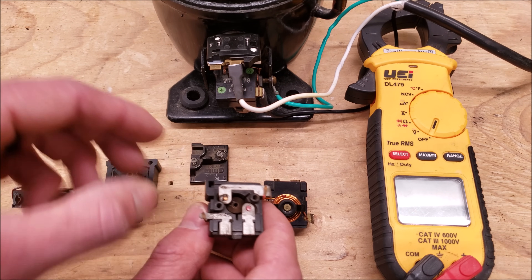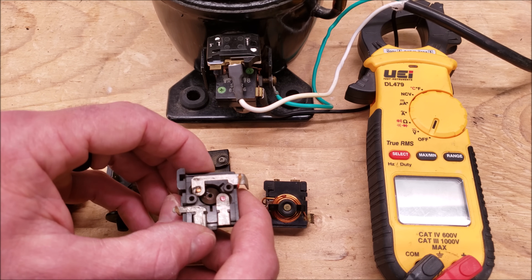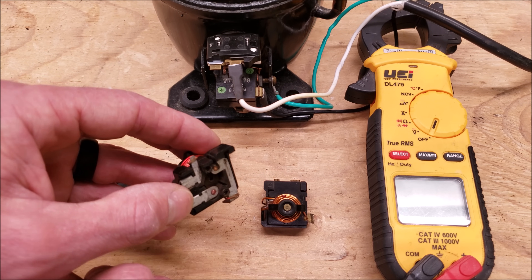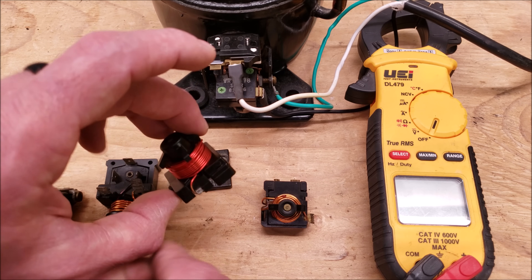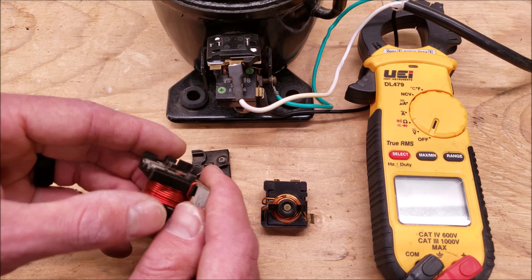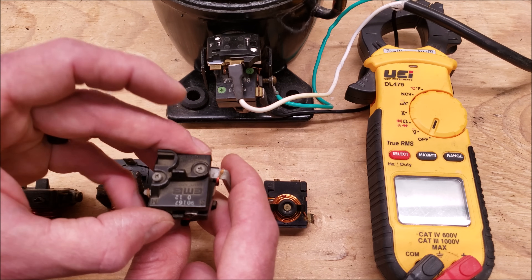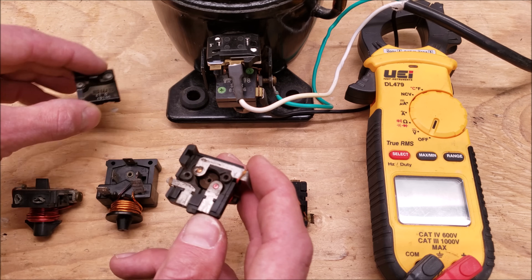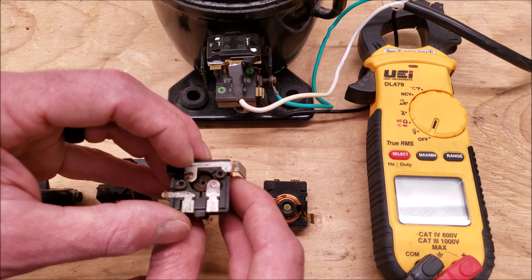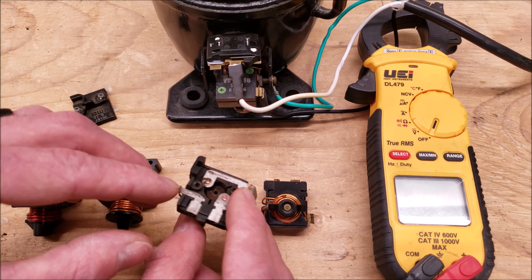Here I have one already opened up — this is the back. Each one may be built differently, but this one has two screws to get to the inside. Here is the iron core on the inside and it'll end up falling down onto those contacts. This right here will be just like this — this is noted M and this is noted S. So this is the start winding right here, and this is your power wire. It comes over to here. This is normally open between these two points, and then you have the wire coming across and going over to the main.